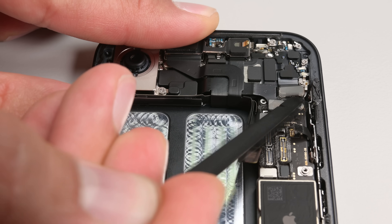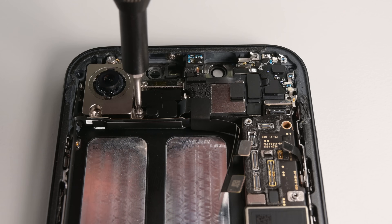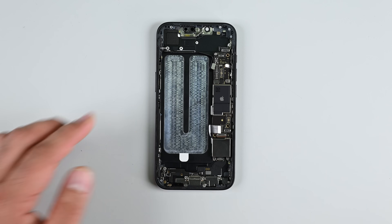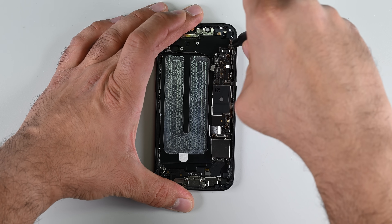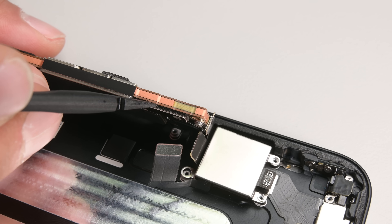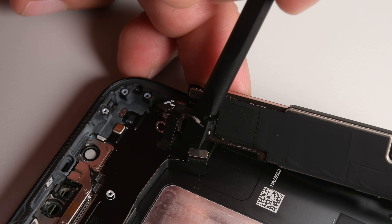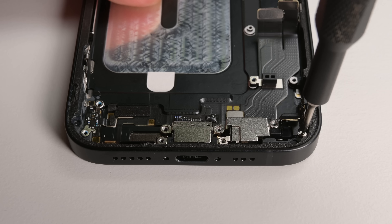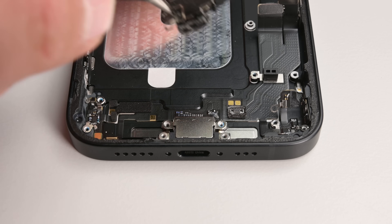But before I can remove the logic board, I need to remove a few of the upper components. First to come away is the IR camera, IR projector, and selfie camera assembly. After a few more screws, I can remove the 48 megapixel main camera, and removing a screw I missed earlier allows me to remove the upper speaker assembly. All of these components needed to be removed so I could get access to this one standoff that pins the logic board's upper right corner to the case. The underside of the logic board provides access to the two flex cables coming from the screen. It's possible to access both of these brackets from the screen side and without removing the back cover. The logic board comes away, and I can finally safely remove the SIM card placeholder. This is how much stuff you have to remove just to be able to get to all these standoffs, tiny screws — both tri-point and Phillips — and a couple of very delicate flex cables that are pretty well glued to the frame.